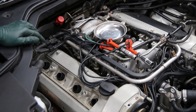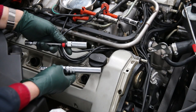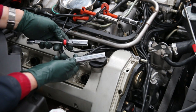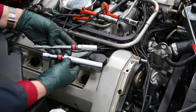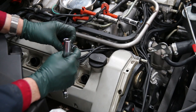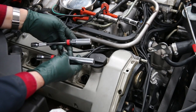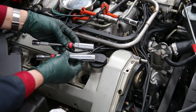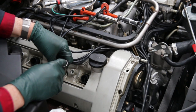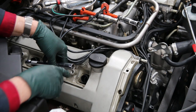Let's talk about what tools to use. You'll need a 5/8-inch spark plug socket — there are a couple of types. I prefer the really deep one on these engines, though it's not totally necessary. What is important is that you have the right length extension, particularly when you go after that rearmost spark plug. You also want a spark plug socket that has a little rubber grommet inside to hold the plug, because once you loosen it, you'll need to pull it out of that recessed hole. I'm going to remove two plugs and show two examples.